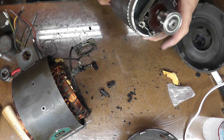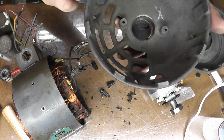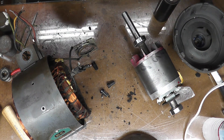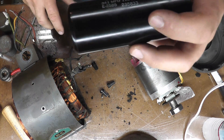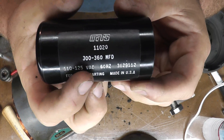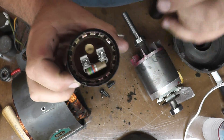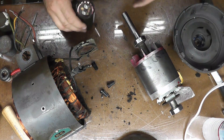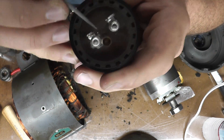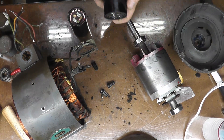To get the bearing out of the rear housing I did have to put in a couple of holes in the back to get a punch through — I'll just tap those and plug them with a set screw. I went ahead and got a new capacitor. The old one was 341 microfarad 110 VAC. Replacement capacitors usually give you a range — this new one is 300–360 microfarad, 110–125 VAC. I already soldered on the bleed resistor. The old one was starting to pucker in the blow-off hole, and there are heat marks and arcing because the terminal was loose.